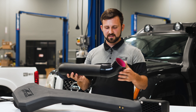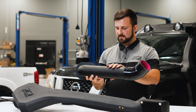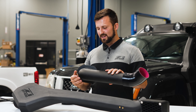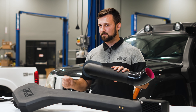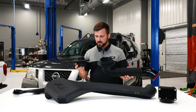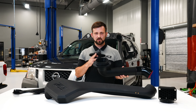All you do is drill a three-eighths inch hole in the bottom of your snorkel and you can simply pop this plug in and out. I've been running the snorkel on my truck for a few months now and I've only had one instance where I really needed to pop it out, and that was due to some really heavy rain. It's still lower than the outlet of the snorkel, so you don't have to worry about water getting into your intake system that way.